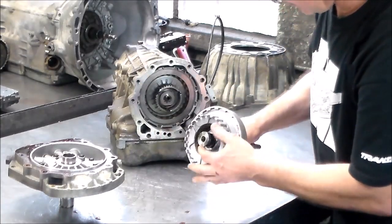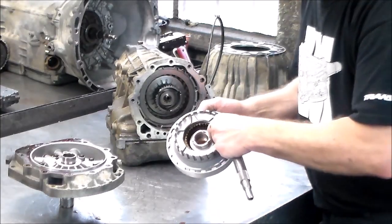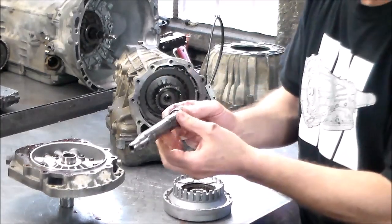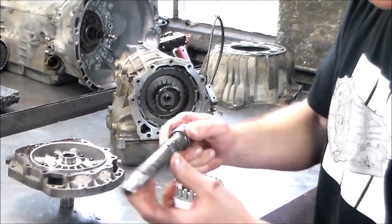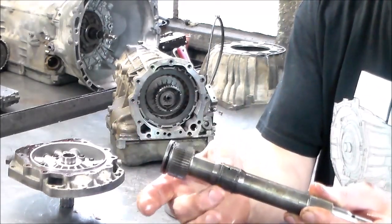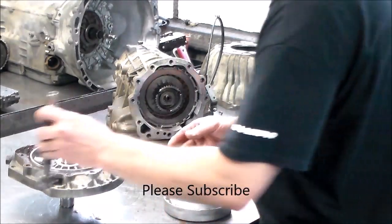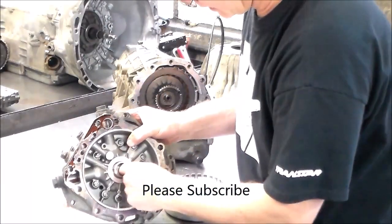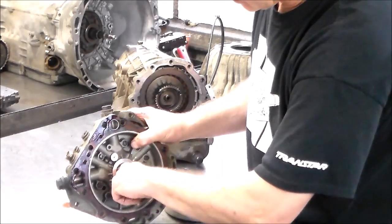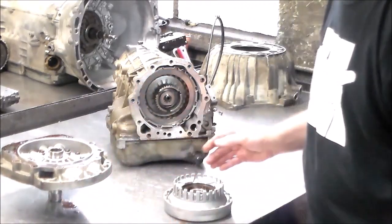Okay. So here is the forward clutch. It looks okay in there. They like a lot of play in these vehicles also. All right. So this has the two metal rings on it, like I knew it would. You got an O-ring here. All right. So again, they want you to replace this ring with the Teflon seal when they give you the update kit. And you also want to check in here to make sure that this is not worn out, because that can also cause a cross leak.